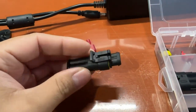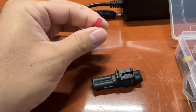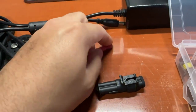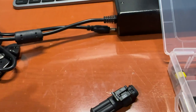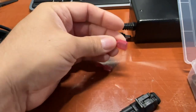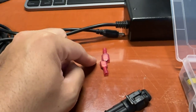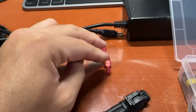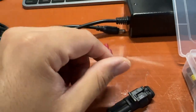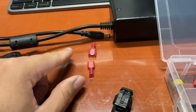If you really don't want the weatherpack and you're in a quick pinch, you can use regular spade connectors. These are individual connectors — it's just a male and a female connected together. They have different colors: red is the smallest gauge, blue is the medium gauge, and yellow is the more heavy gauge — meaning the thickness of the actual cable. In this case the reds and blues would work just fine. The yellows would probably be too large a diameter to crimp correctly.